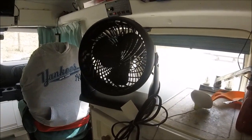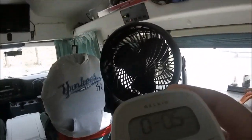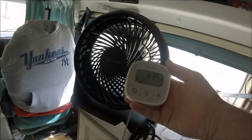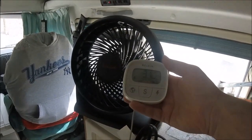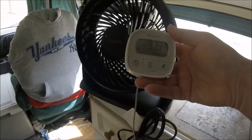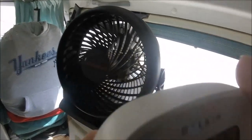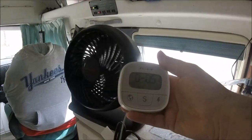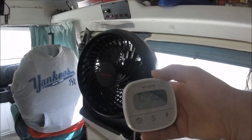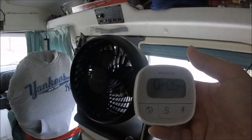This is kind of a twofer — this is how much power does stuff use, and this is also a thrift store fan I got. Alright, we're plugged in on low: 26 watts. Medium: about 31-32 watts. And there it goes on high: just under 38 watts. So if you're looking to try to keep your RV cooler, whether you're using shore power or running off of batteries, that's how much this Honeywell fan uses. And it kicks out really good air.